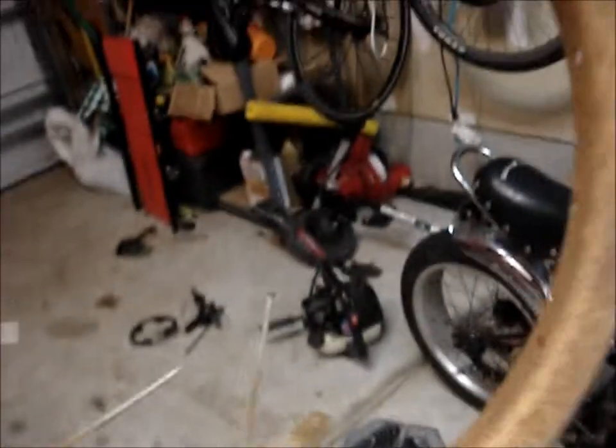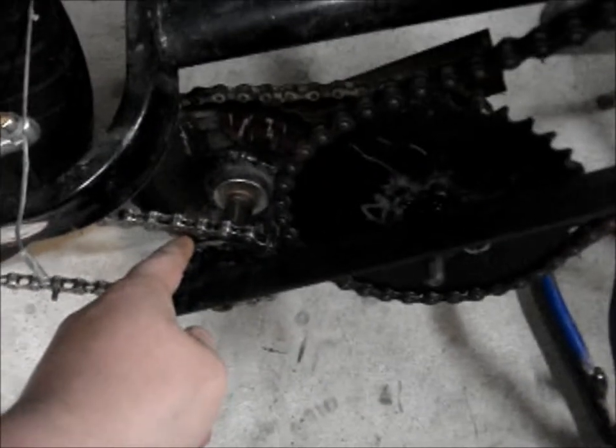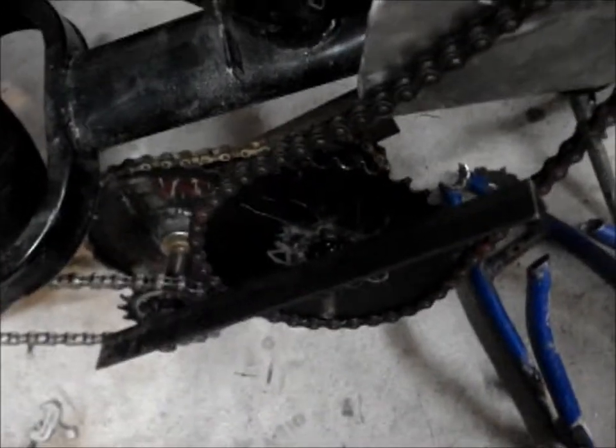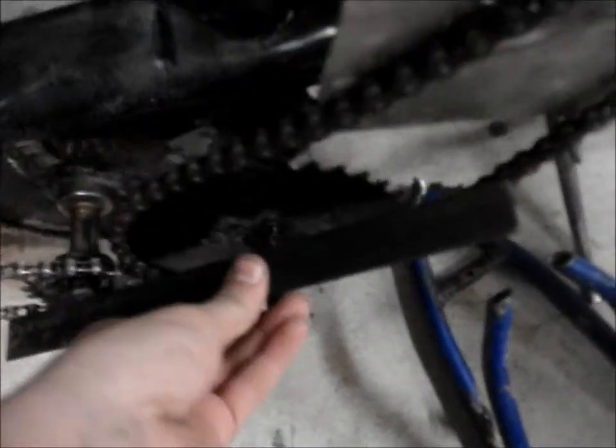On this one I actually cut the spokes — most of the time I do take it off the right way, but on this one the spokes were rusted on there pretty good. I just welded the sprocket onto one side and same to the other. It was actually very easy, except for this black sprocket which is on there a little wiggly — they're not perfectly straight because there was nowhere for it to sit really, so I had to just get a tack weld on there and build off from there.